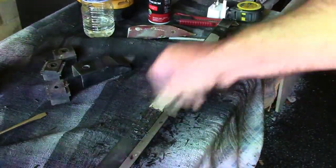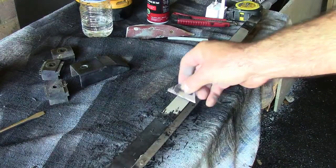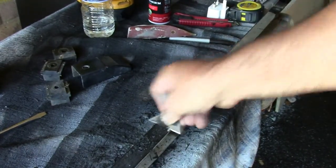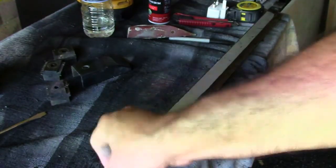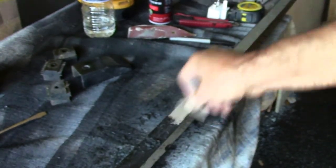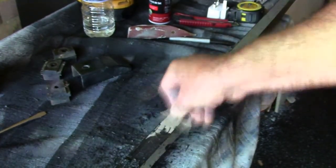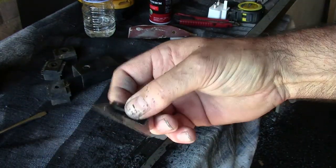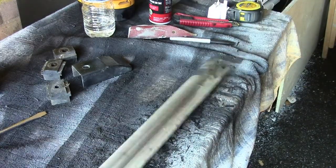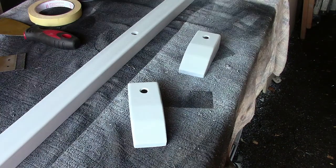It wasn't etch primed, so the paint didn't stick. It's stuck to a certain extent, but it starts to chip off in a few places — water gets under it, the weather gets under it, which is mainly water. A couple of winters later and you've got little bits and pieces hanging off. It looks crap. The whole van has been roller painted so it's never going to look brilliant, but it's that utilitarian aesthetic that I like. Occasionally you get really thick parts, but other than that, just a blunt Stanley blade — it's done that much in the same time it took me to do that much with sandpaper. You can see I've rubbed it all down. I totally overestimated — it only took two and a half hours to do that big long bit. The paint wasn't very sticky on it; it came off quite well with a new razor blade.